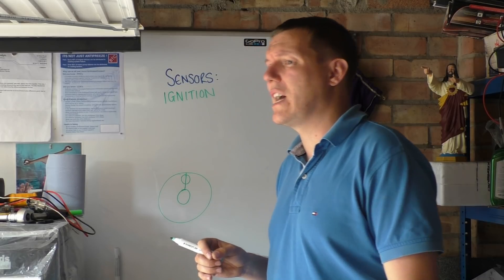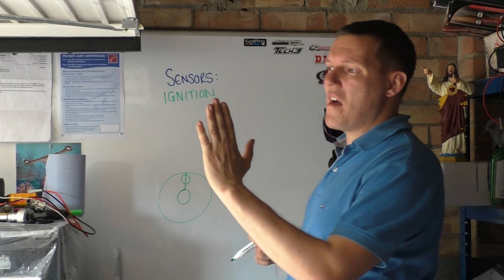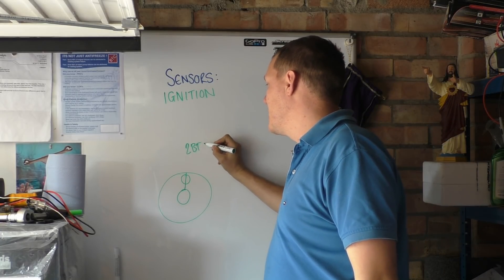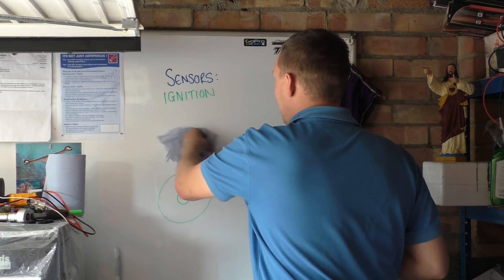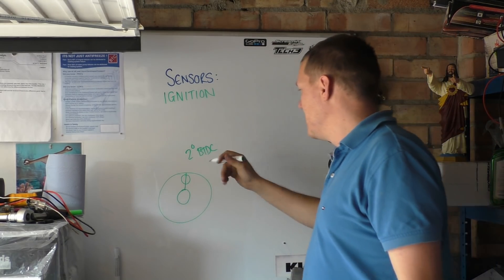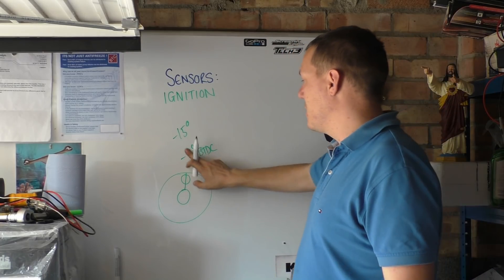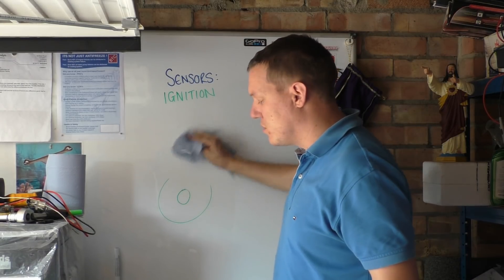Now some sensors are just set to plus 10 degrees, some sensors are set to zero. It doesn't matter as long as — basically what happens is if you never, ever fire on zero, then don't have your marker on zero. There's no need to do that — that's basically stupid. If you always fire two degrees before top dead centre, then you never need to set your crank to zero and then always dial it back two. If you go from here and then you retard it by 15 degrees, then this might as well be zero and this might as well be 13. You don't confuse the situation. So for two strokes it's easy.